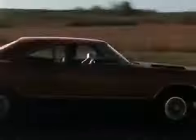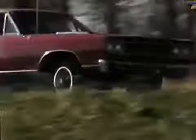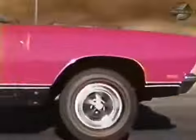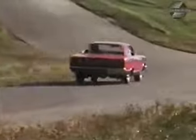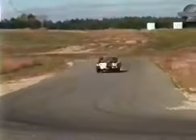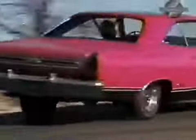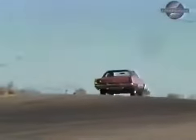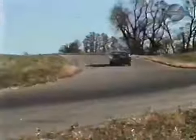The GTX is a strong performance car, and we gave it a hard workout. This heavy-duty suspension system has a big, beefy feeling that invites hard cornering, and the wide polyglass tires give an even greater margin of security. In the front end, we had wishbones with a big, fat torsion bar, and under the rear end they employ semi-elliptic leaf springs with a live axle. Steering is about neutral at moderate speeds; however, in high-speed cornering there's a slight hint of oversteer. But with the throttle connected to that big 440 cubic incher up front, you can bring it through in an easy four-wheel drift.